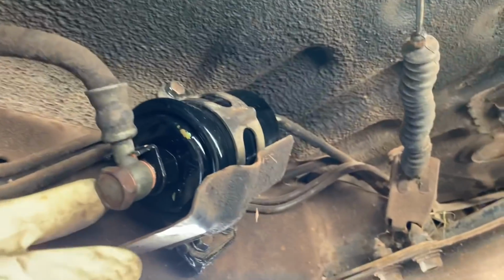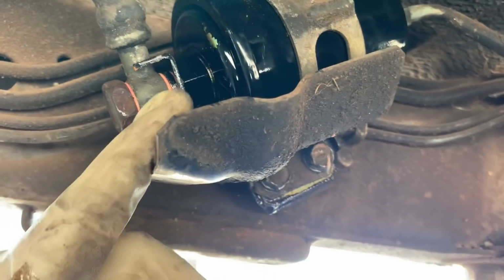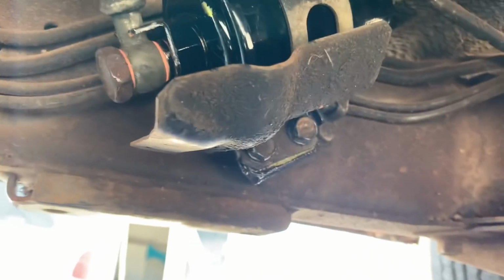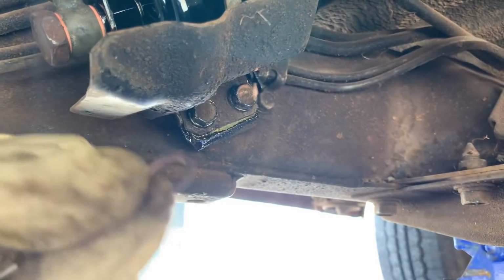All right, so here's what we've got going on. I've got the new fuel filter installed. Now the back side doesn't use washers. It's threaded in. It's got a little beveled pitch, and it just screws in tight. But this side has 2 copper crush washers, and the filter comes with new ones. Here's one of the old ones. So make sure you change these out.